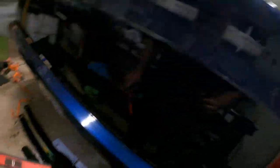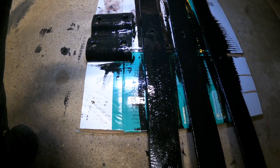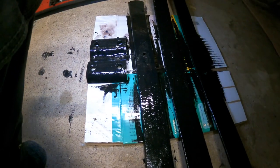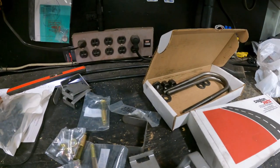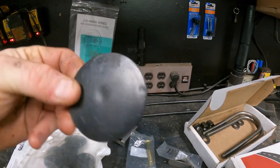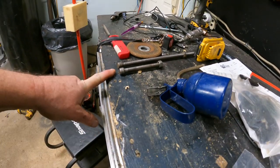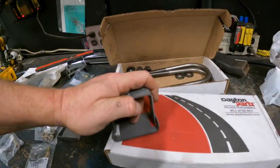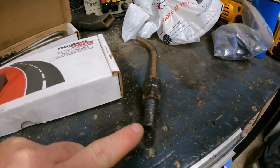You're still going to clean that and paint it up. There's the leaves over there all painted up. There'll be three leaves altogether — which on a drop leaf, that's all there is, is three. Then we'll have the weight transfer bar, or leveling bar, whatever you want to call it. I got them all painted up and they're all ready to go back together. We got new hardware: new U-bolts, new little sliders that go into the leafs so they don't rub metal on metal, the actual bolts that go through the leaf springs to hold them together, and the brackets that wrap around and adjust to where you want them on the leaves.